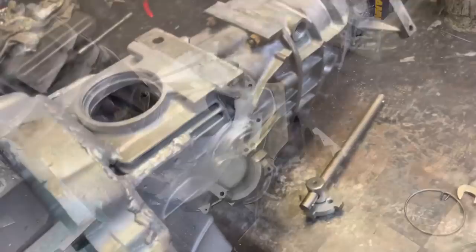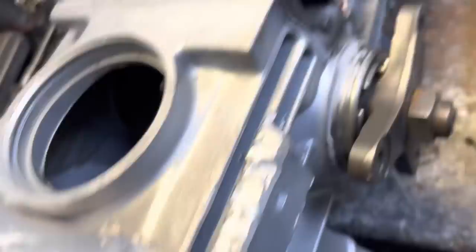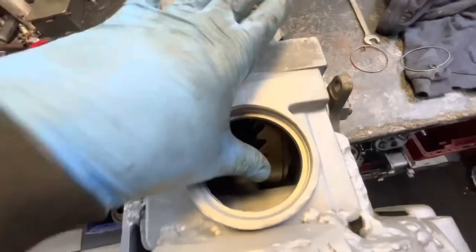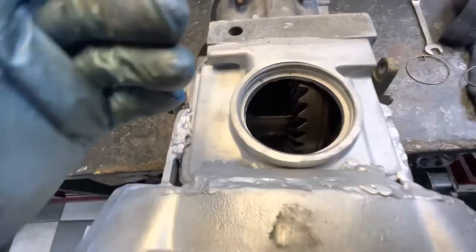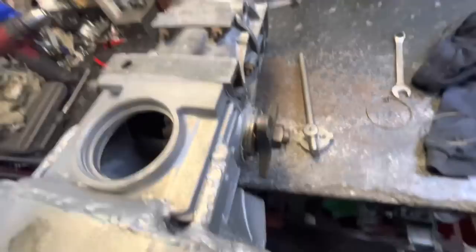We're on the home run with this box. I've tied all the bolts up around the differential housing, it's all clamped up nicely with goo, everything seems to pinch, and the diff is nice and smooth. You can see the whole thing goes around nicely. The backlash between the crown wheel and pinion is really important - that clunk is basically five thou clearance between the pinion gear and where it meshes into the crown wheel. It's important because that's where the oil sits to lubricate it - we don't want it too tight so it binds up and gets hot.